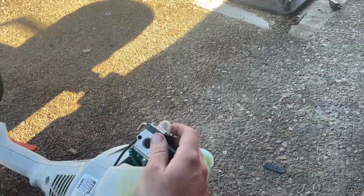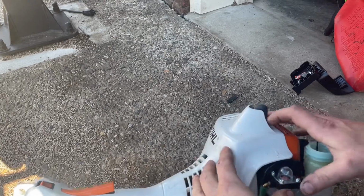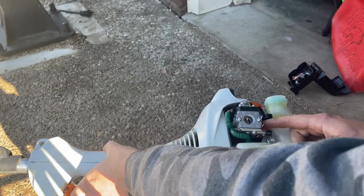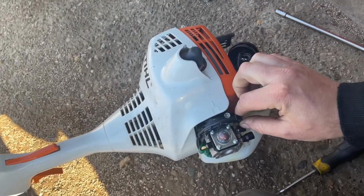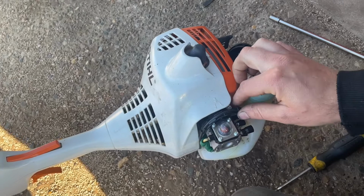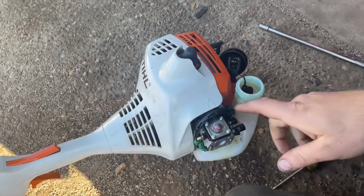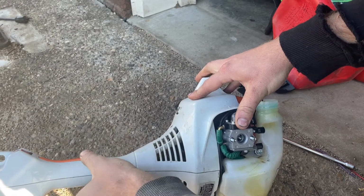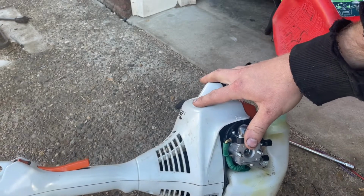Put it back together here. So like this here has to, there's a little piece that sticks into a hole back here. Stick it on there like that. So that seems to be making decent contact with where it needs to, but this is not working right. It's not opening up all the way. So we'll have to turn this screw down here. This screw pushes on the manifold, brings this up and down. That's the way you adjust the cable apparently. So that's how we're gonna do it, just with this. Maxed out the adjustment, it works. So that's fine. Kinda junky though, but we'll give it a try.